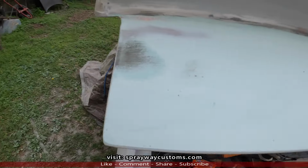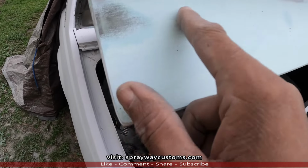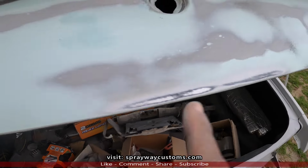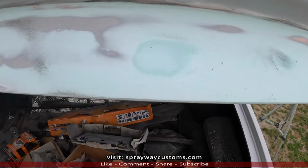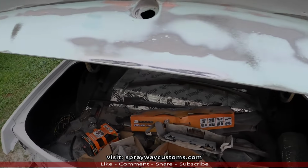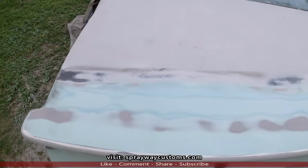And on the back part of the deck lid, this here is somewhat low. That's low, that's low. This here is low. Also here. So I'll go ahead and fill those areas, then in the morning we'll block those down, get ready to shoot